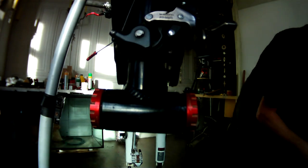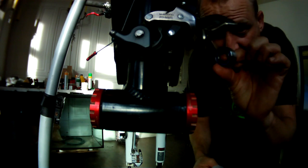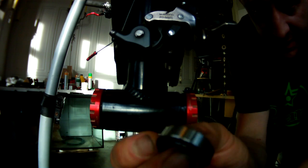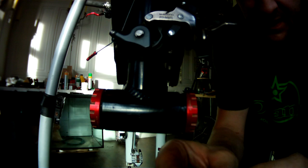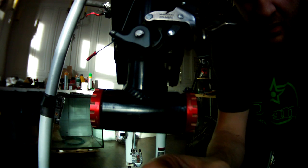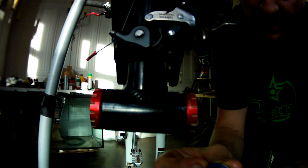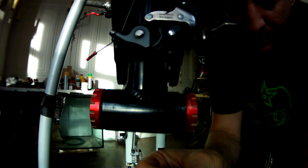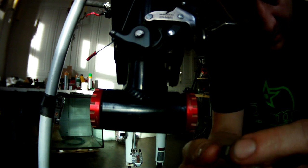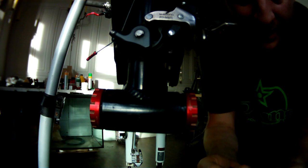It's at that point we get the fresh bearings, the new ones, nice stainless steel ones. Their reference number is 6903. Sorry, 6903. Yeah. 2RS, two rubber seals. Obviously get the stainless steel ones, they're way better.